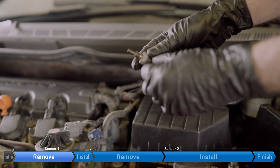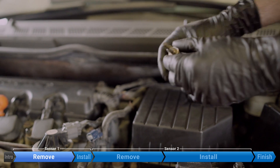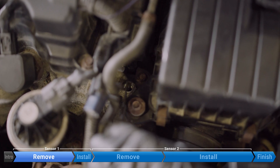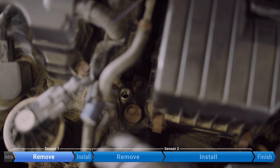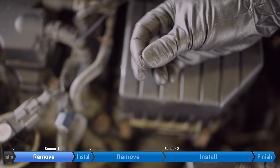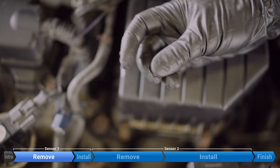And here's the old sensor. One thing to notice — there's an O-ring that should be right here. It looks like it was left behind, so I'm going to grab a pick and pry that out to make sure we don't accidentally put the new one in with two O-rings. Sometimes the parts come without an O-ring — would it be okay to reuse the O-ring? In an emergency you can, but it would be a really good idea to replace it. If the new one didn't come with one, you could probably get one at the Honda parts counter — we'll include a part number in the description.